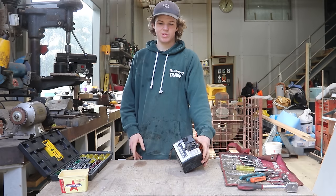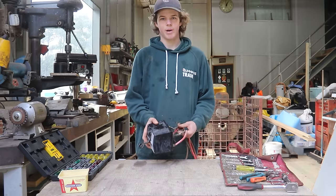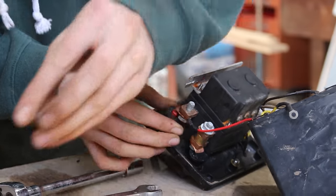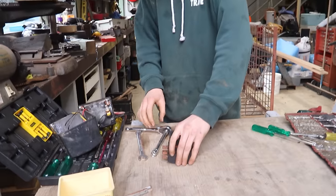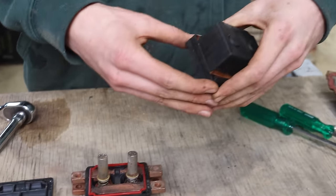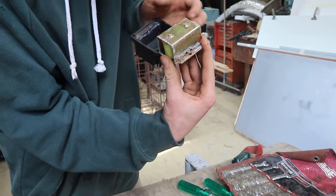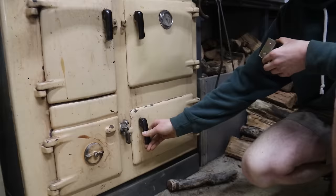Because the winch was in perfect condition from what I could see, I'm going to go to the root of the problem which is the solenoid box. Just got it off the car here and we're going to start taking it apart. You can see there's a bit of corrosion in there, a little bit of rust and things. So we've got our solenoid separated from the terminals. We take off each section — there's a bottom casing, then the main section with all the contacts and the solenoids, then another separated dish, and then in here are your coils. Look how grubby that is — there's corrosion all through it and there's actually moisture in the coils.